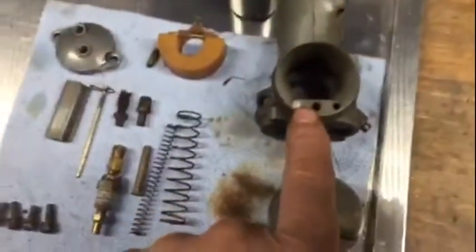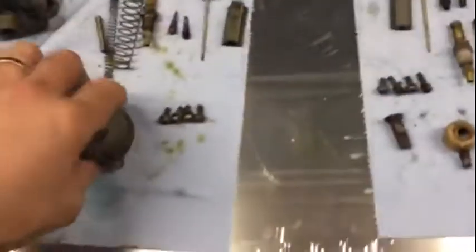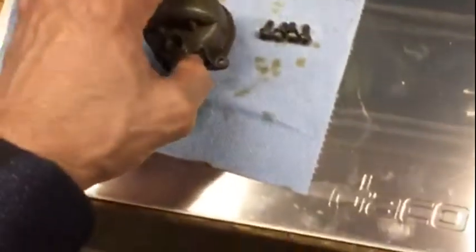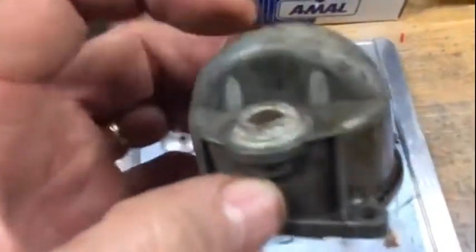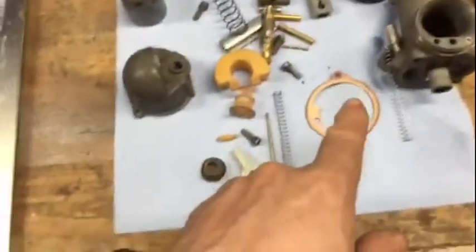All the carb bodies on the 930s are identical - there's left and right. You can see where the plugs are on the left side, and on the left carb the plugs are on the right side, and vice versa. Somebody's drilled that plug out. When I took apart these float bowls they were full of water and rust - you can see the inside all corroded up. I've got to somehow save these. But on this one when I took it apart I was able to get the drain off it - this one, the drain snapped right off. It broke right off in there, no way to save it, just corroded right in there, and that's why I bought this carb on the internet.